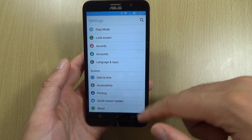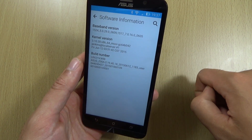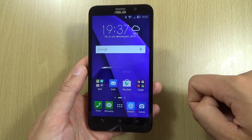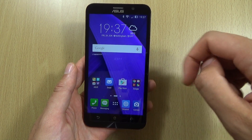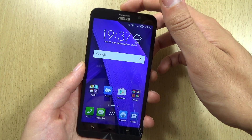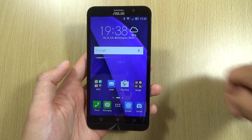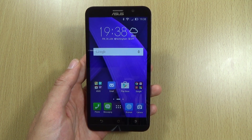I have noticed however since the last update — the software update ending with 18 which came in early June — the battery life seems to be a little bit better. I did actually factory reset the device and also do a wipe of the cache. You can do that by powering the device off, pressing the top button and the volume up button, holding them together until you see the recovery environment. Then you have to do it again and you get access to the cache wipe options. I definitely recommend you do that because it does definitely help with the battery life.